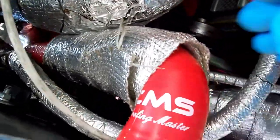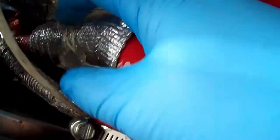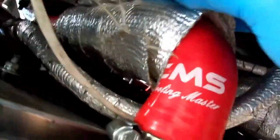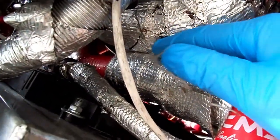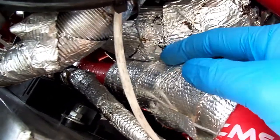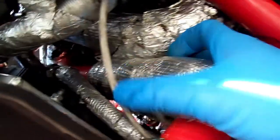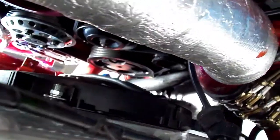Another problem is down here. I just realized it as soon as I had to deal with the melt up there. This one is also touching - the radiator hose right here was touching the turbo pipe. The pipe turned somewhat brown; it was going to melt eventually. Luckily I noticed right away. I'm going to heat wrap all that to get better heat protection and isolate it.